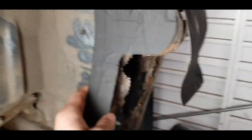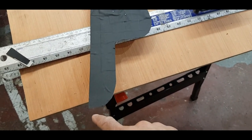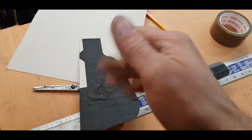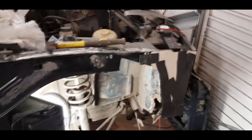I'll save these bits for when the car turns around — though it's lacking a main component, mainly an engine, so it won't be turning under its own steam anytime soon. I'm going to get some thin steel and trace that out, but I'm going to leave about a 10mm gap on this edge and try and tap a lip onto it in the vice. Eventually when I cut the outer panel part onto it, I can drill some holes and plug weld it onto that lip. A spot welder would be great but it's probably a bit late in this restoration — the bulk of the welding is mainly done now. I've just got the front section left and a little bit of the back to sort out.